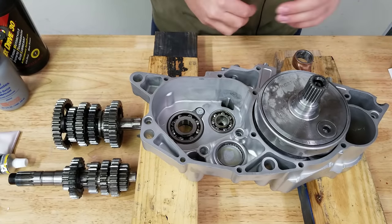You have your shift drum and these little grooves are what the shift forks ride in. What you want to do is spin the shaft — not by the gear, by the shaft — and you can see where it stops when the shift fork peg bottoms out the shift drum. You want to make sure you can go all the way around and work through all gears, checking that there are no obstructions. I think we're maxed out and good here — I'll double check off camera and then we'll move on.